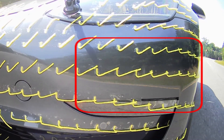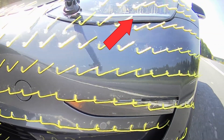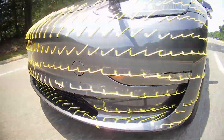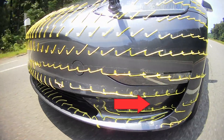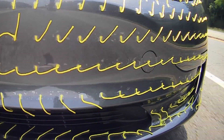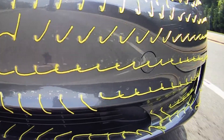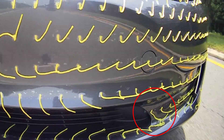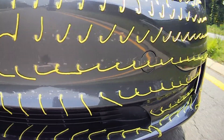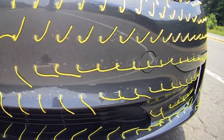Moving towards the side and around to the quarter panel and headlight area, the streamlines go right around the side, and as we move up, it goes a little bit more vertically. I estimate all of this air still ends up going around the side of the profile of the car rather than over — probably along the side of the door, side windows, and mirrors area. The air curtains at the front wheels are one of my favorite aerodynamic features of the Model 3. The streamlines from the lower recess lead directly into the air curtain intakes, and we can suppose there is nice high-velocity air coming through those curtains, shot straight through the curtain slot and around the side of the front wheel — this is how the air curtains reduce drag around the front wheel wells. There is clearly air coming from inside the intake recess and spilling back to the side, causing turbulence, and this appears independent of whether the louvers are open or closed. If there's any one aerodynamic finding I would thumbs down on this car, this is it — but it's probably a small thing.